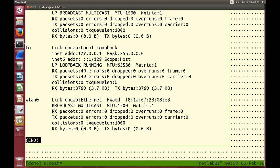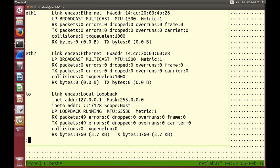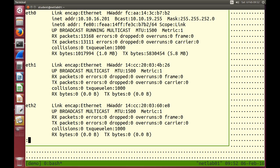And the way that we've set up these computers is, assuming everything's correct, eth0 is always the network interface on the motherboard. This is a useful one to remember. eth0 is on the motherboard. eth1 is the top PCI slot. eth2 is the bottom PCI slot. Right, 0, 1, 2 physically, because later when we plug cables in, we'll need to know which one we're using. So the operating system gives them names.